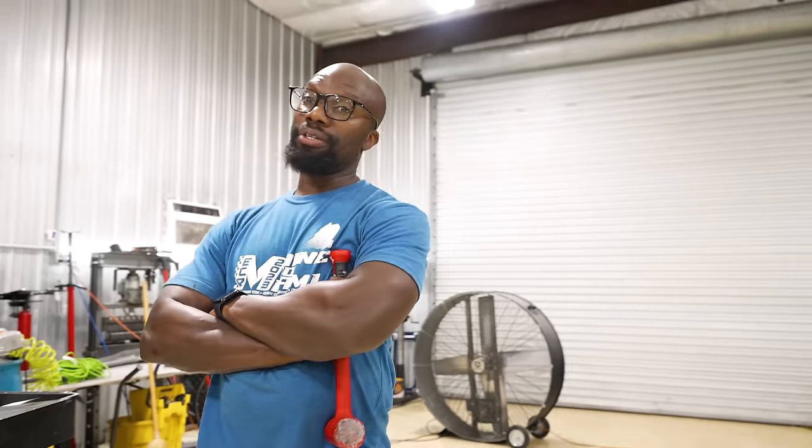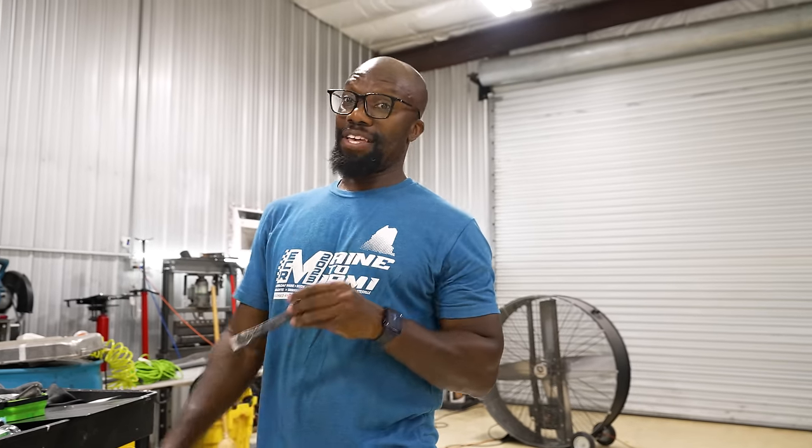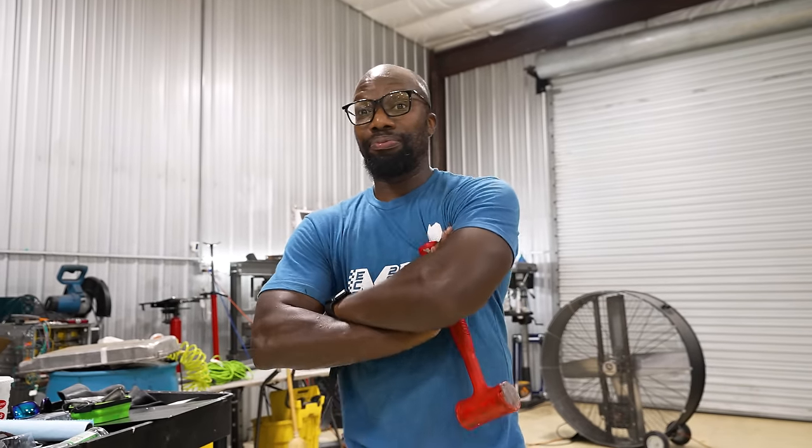We'd have to find a friend with a P1, and you'd have to do some CAN bus sniffing to figure out what the car's looking for. And then get a decent DC to DC converter. There's not really much to that pack module-wise. The DC to DC converter seems like it works. You could get a different one, probably a better one. Okay, but are there any upgrades that we can do?